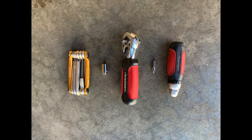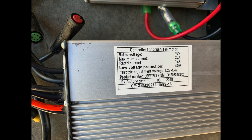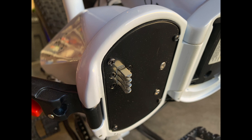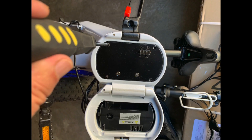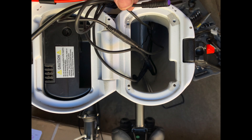You will need a few basic tools for this upgrade. You would need to install the new 25-amp controller, which is similarly sized to your old controller, so you should not have any problems installing it in your bike's controller cavity area. All the cables are color-coordinated, and the new controller is plug-and-play, fitting perfectly with the cables on the bike. One item of note is the new throttle cable is blue, and it matched the 5-pin cable on my single-speed bike.